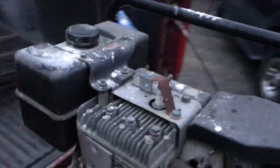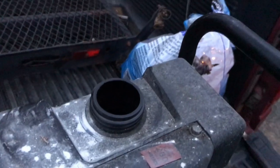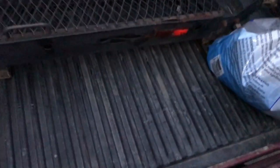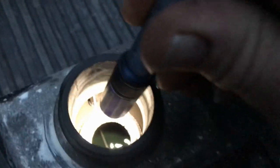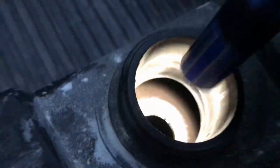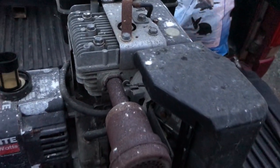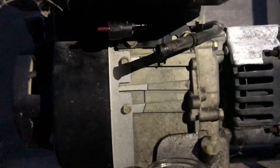While we're here, let's see if there's any gas in it. The gas cap didn't smell very good. Let's get the old flashlight out — it's got a screen in it, and the screen pops right out. Looking inside — nasty, it's got some really nasty-looking green gas in there. Stupid ethanol gas turned green. We're going to have to clean the tank out and the carburetor will probably have to come apart.